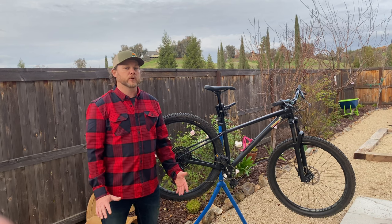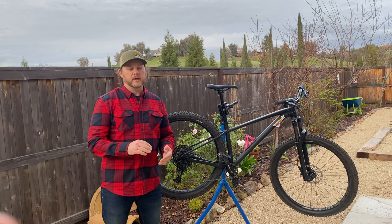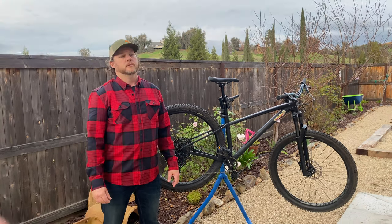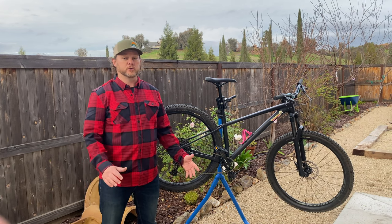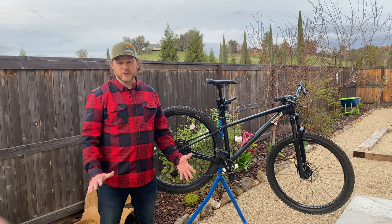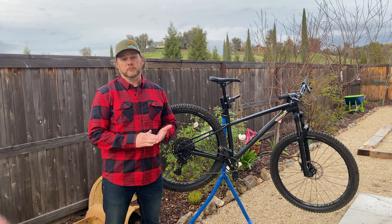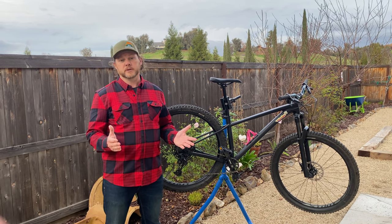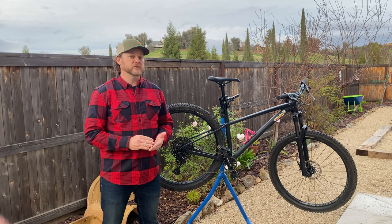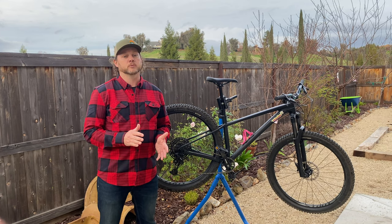I was skeptical about how this would work when I first bought it because I was afraid it would be difficult to set it to a point where it wouldn't bob under normal pedaling but would still soak up impacts like smaller rocks. Basically I was hoping the valving was advanced enough to do both things at once. Fortunately, setup was really easy. I started about in the middle of the air pressure range and made small adjustments from there as my wife rode it. The first thing I wanted was to make sure it didn't bob under normal pedaling, then it was just a matter of seeing how soft I could make it before it did start bobbing — basically soaking up as many bumps as possible without interrupting the pedal stroke.